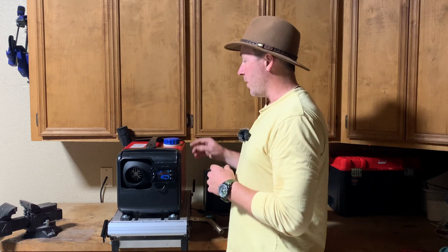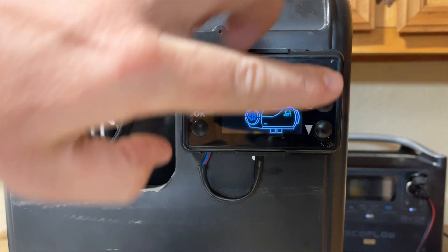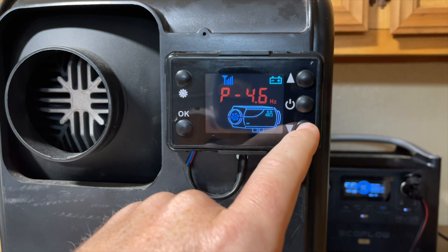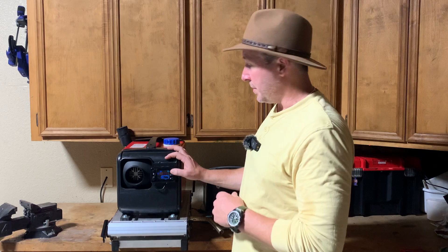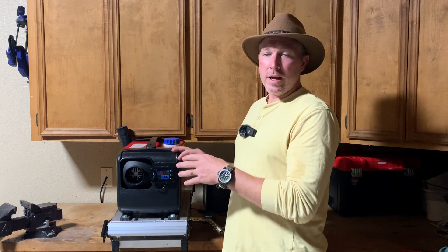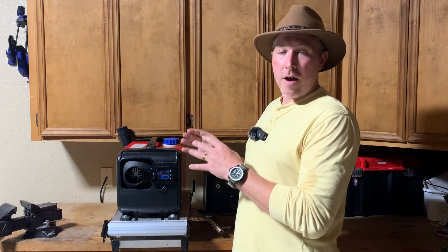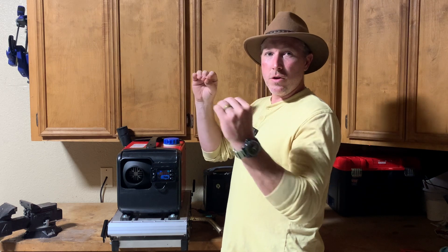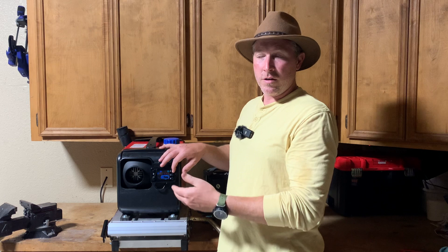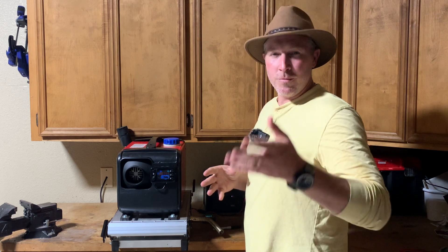Let me go over a few of the functions first. You'll have what's called the P heat range, or power heat range. You'll have a range from 1.4 power to 5.4 power — that's the heat level. What we're going to do is adjust our fan speed and our fuel mixture to correspond with those particular settings. We find the most efficient settings at the low setting and at the high setting, establishing a new range. Everything you adjust in between will then move linearly, maintaining efficiency all the way through the range — which is the whole point of this process.